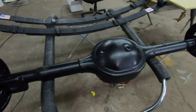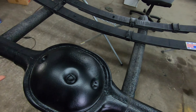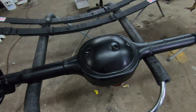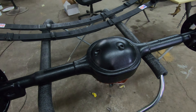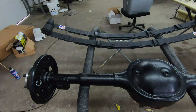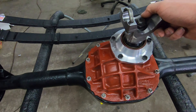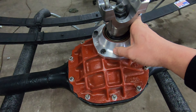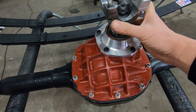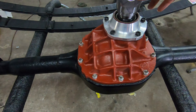This 8-inch differential we actually built here — we did not get to film this, but I do plan on filming a differential build video and eventually adding it to the playlist. When converting from a six-cylinder to an eight-cylinder, you do need at least an eight-inch axle housing. You can go with a nine — kind of depends on what power you're adding — but we're trying to keep this car a nice cruiser, so we opted for a stock, concourse-correct 8-inch differential.